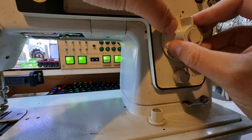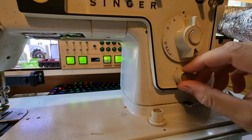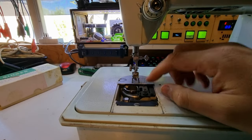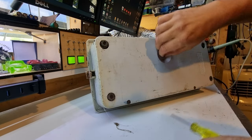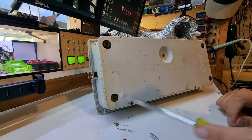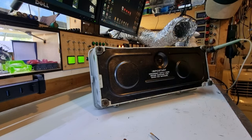That is very stiff and has not returned to position, so definitely some lubrication needed. I think this may have suffered the same fate that a lot of Singers do — there's a gear down here made of plastic and it shears off, though you can still get them. There are a couple of others down there with felt washers. These are usually long screws and are separate from the foot base.